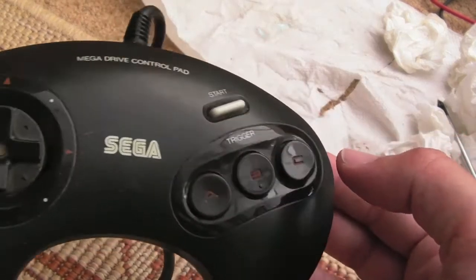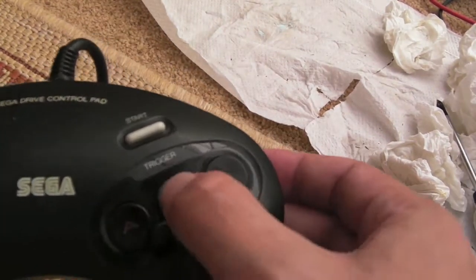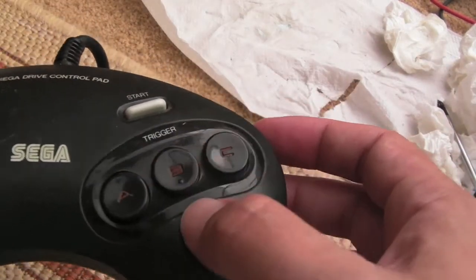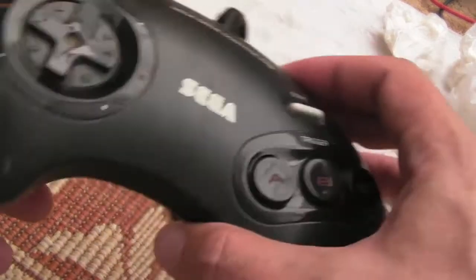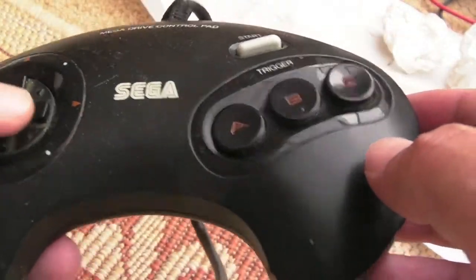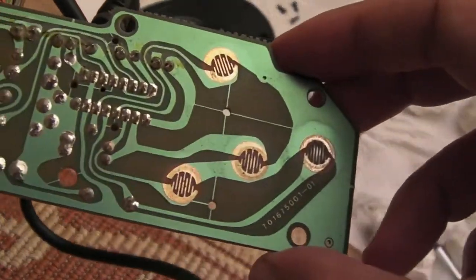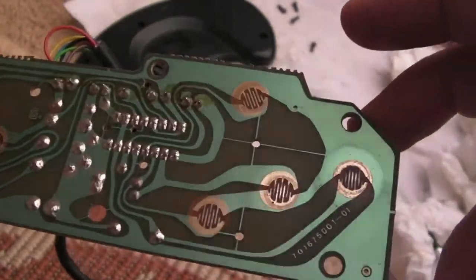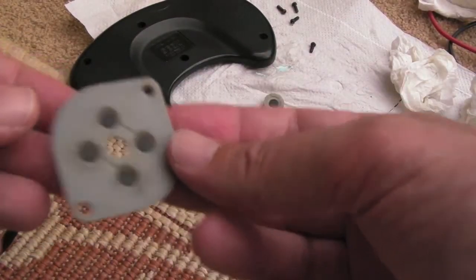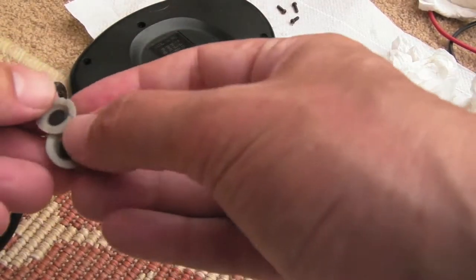This one has some damage, probably to the cable, and it's really dirty. I'm not sure how well this is going to come out. The down direction's not working at all, A and B are doing nothing — I think C and Start are working. There's also something rattling in it, which is probably the little plastic bits on the end of the D-pad. Those only really break off in transit, not from use. I can't see any immediate problems inside apart from it being pretty dirty, and these contacts definitely need cleaning up — they're pretty filthy. The carbon pads have seen better days too, but none are split, so I'm just going to clean it, reassemble, and see what happens.